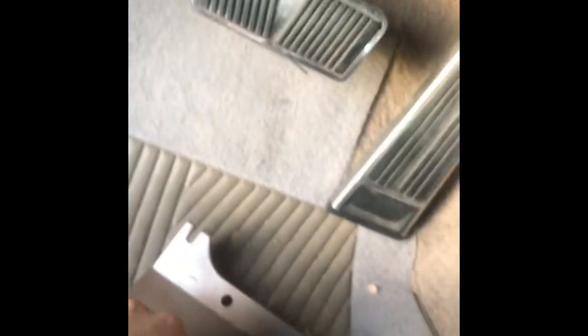You got Phillips screws there, there, and there. You kind of do need to take this off. Now, this little piece right here is what stops you from pulling the cover off. Everybody's in here trying to unscrew stuff and it's not working — there's a tiny little Allen bolt right there. It's like a size 10 or something, it's stupid small, and that's what holds this in. That took me like 30-40 minutes to figure out.